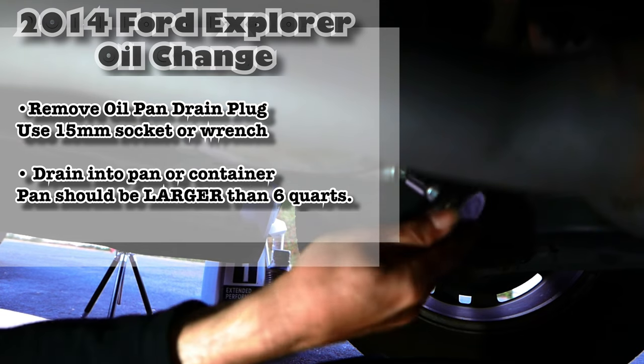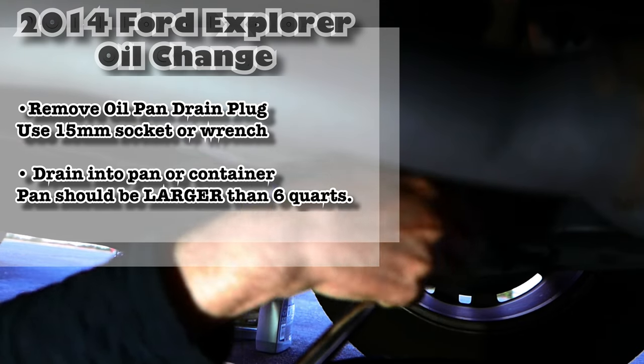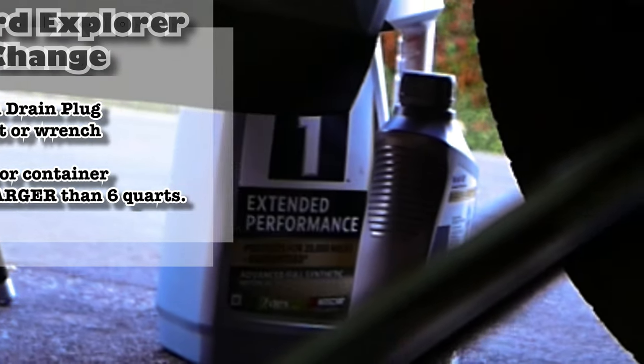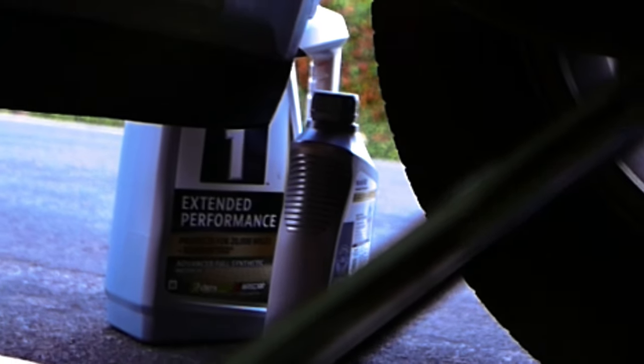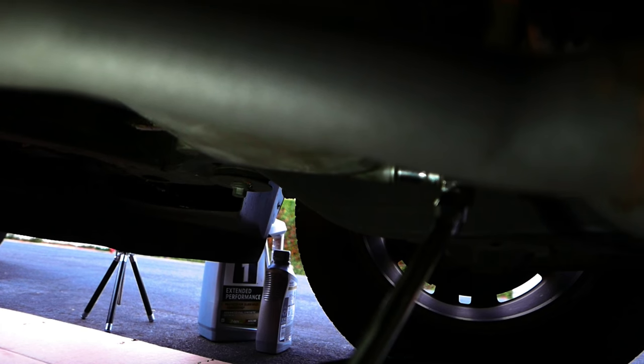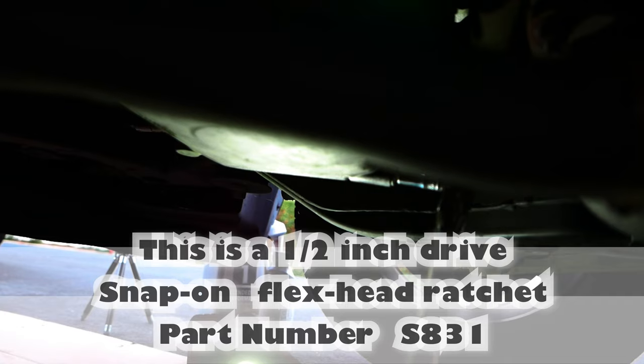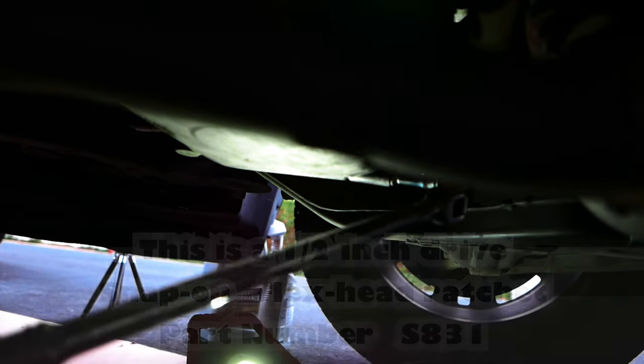Now that I know I have at least one or two little extra jobs, back to the actual oil change. You're going to need six quarts, which is one five-quart jug plus one extra little quart. I'm using the 15mm socket. The pan doesn't need to be there when you're breaking it loose. That drain bolt is on tight — I have a feeling somebody used a power tool on it. Laying down and reaching up, you have almost no leverage.